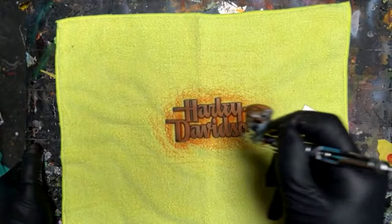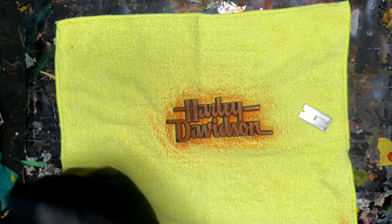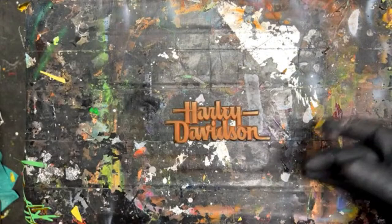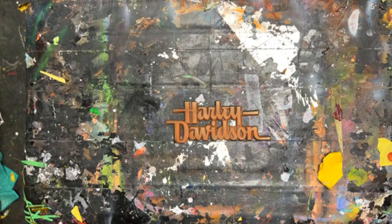Keep Steady said that he's painting a skateboard, not a car, talking about using the Cretex. Oh, a skateboard? No, you can use it. You can even use Cretex on cars. It's going to be a little bit more of a learning curve because you have to be super patient with waterborne paints. It doesn't go on as quickly, so you have to apply it really slow, kind of building it up. And that's hard to do with the trigger if you're new to it, you're going to have to learn that. But that's why I feel like solvent-based paints are the way to go. But they all work in their own ways.